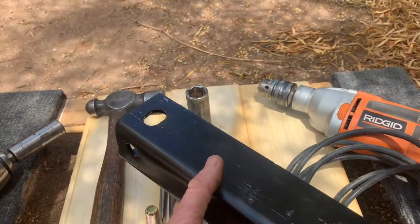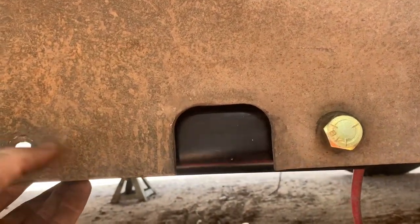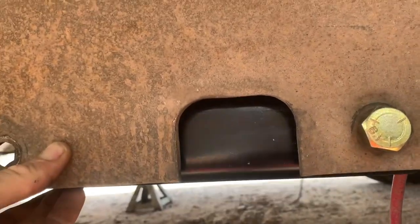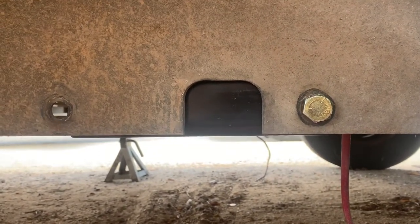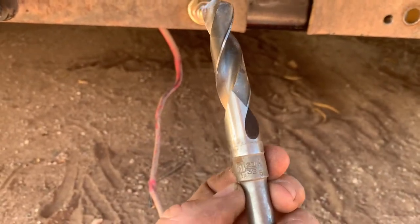One of the holes lines up, but the other one doesn't — we'll show you that right now. I already have one bolt in. Clearly it's loose. One hole lines up, and as you can see, the second one does not. So that's where we have to drill a hole right here where my thumb is. I'll tighten this bolt right here, get it nice and flush with the bottom of this frame, and then we'll drill it from the inside out. That bolt is tight. There's the existing factory hole, and right here you have to drill a new hole. The final size drill bit you'll have to step up to is a 21/32 inch.